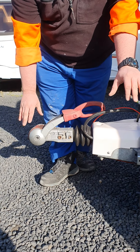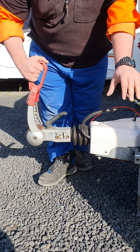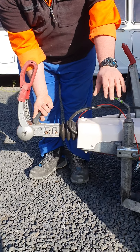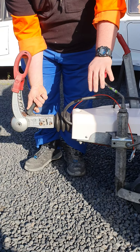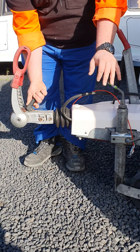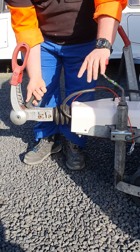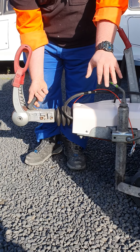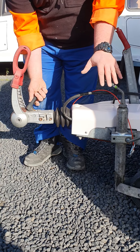When it comes time to remove it from the vehicle, lift this first one up. You then have to lift and hold this black lever up while you use the jockey wheel to take it off the tow ball. If you don't hold it up, it'll just try and lift the vehicle and the tow ball with the caravan. So just make sure that you hold that up until it's off.